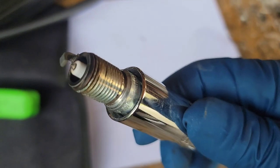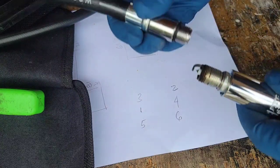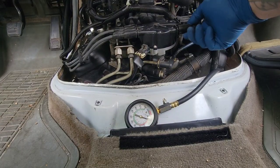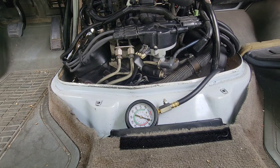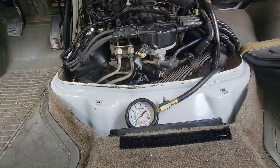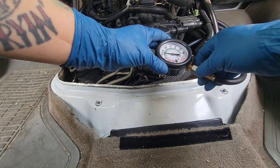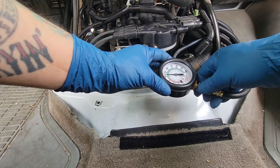It's my number two plug. Looks pretty good to me. I'm going to use this to compare to the adapters — looks like it's the largest one. I'll go ahead and hook that up and try to run this up through the engine compartment. I'm going to pull this coil wire — easier said than done. Okay, that's off. Now I'm going to crank this and watch the gauge. That says between 120 and 150 — I guess that's about 130. We're going to call that. Let's write that down.